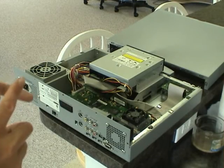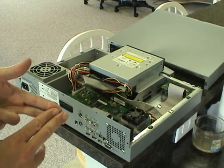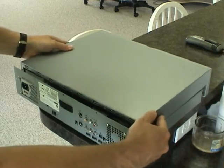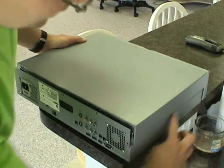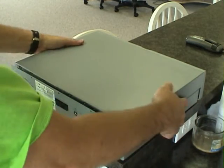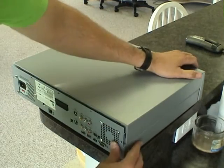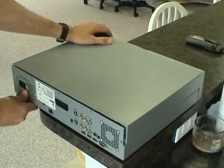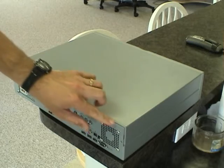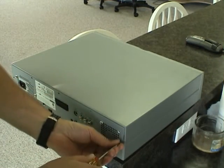Once you have finished upgrading your RAM or DVD drive and you're ready to place the case back on your Casablanca machine, simply position it with about an inch gap and rotate it until it fits into the slots. The seam along the right-hand side and left-hand side should be even with no gaps. Feel along there, then push a little on one side and then the other, going back and forth until there is no distance between the back panel and the top half of the case. Then install your five screws.